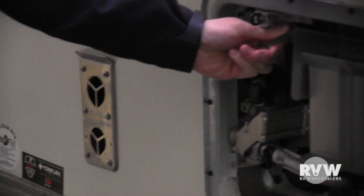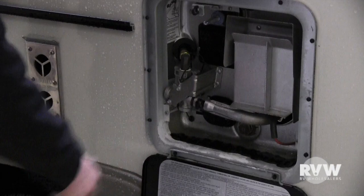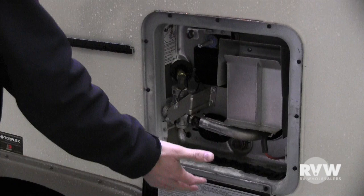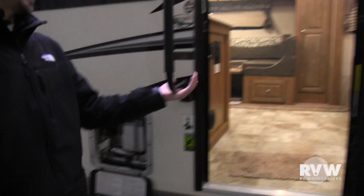This is the backside of your water heater. Lift up on this — this is going to be your pressure release. It is a gas/electric water heater. The gas switch is on the inside; there's a little on/off toggle switch down in the bottom left for the electric side. This is also the drain plug for winterization. When you first fill it up, come out here and make sure that's pulled up so it can release the air as it's filling. Once water starts pouring out, close it off — that means it's full and you can light it.